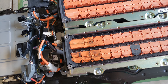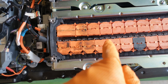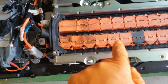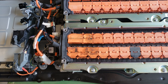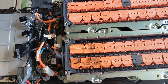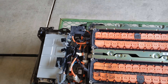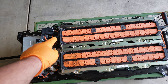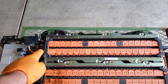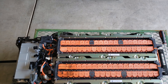Complete failure. I'm not going to try to swap cells — I don't know how many were damaged by electrolyte and I'm not comfortable pulling this apart any further. At this point I'm just going to be getting a replacement battery for the car. Maybe I'll get courageous and disassemble it to part things out on eBay, because we've still got a good high voltage junction board, a good DC-DC converter module, and a brand new battery energy control module. It seems like at least this bank of cells — I think there are 38 total — maybe 18 or 19 cells that are still good.